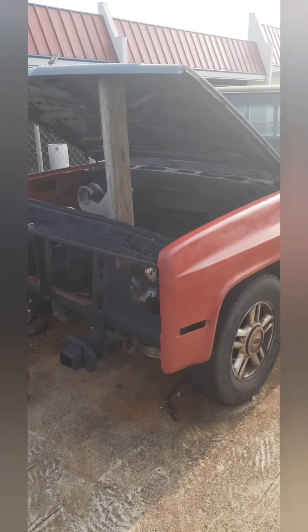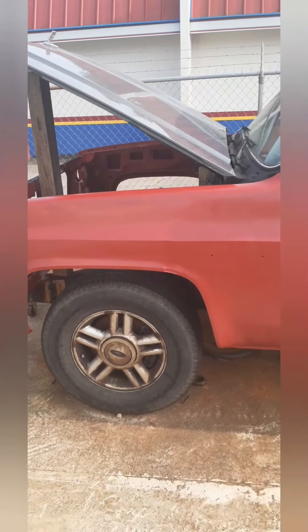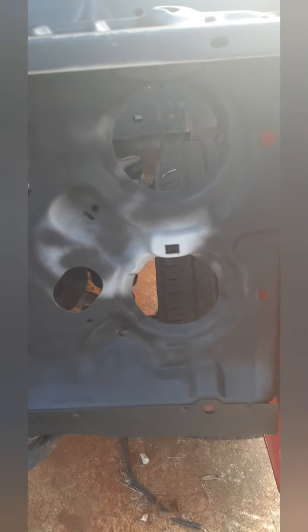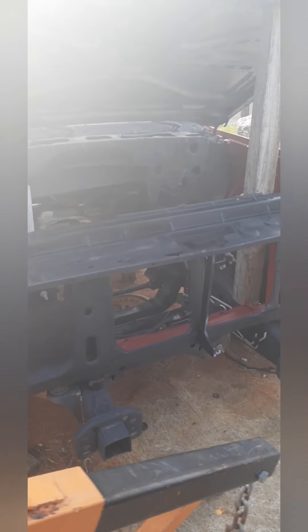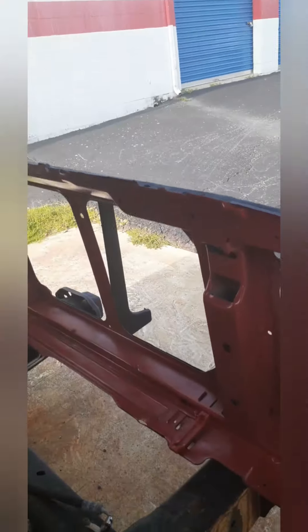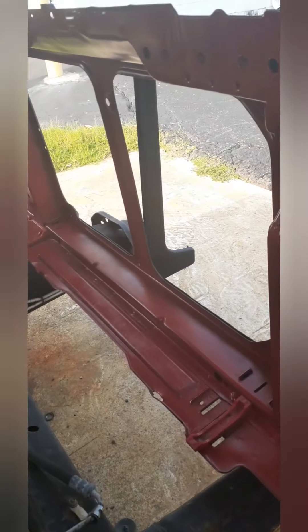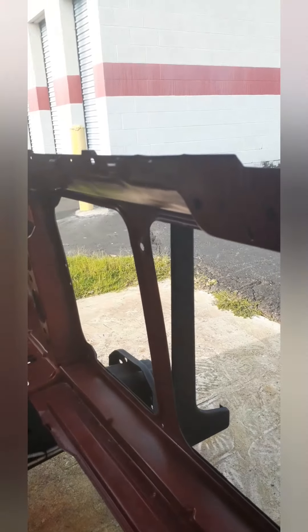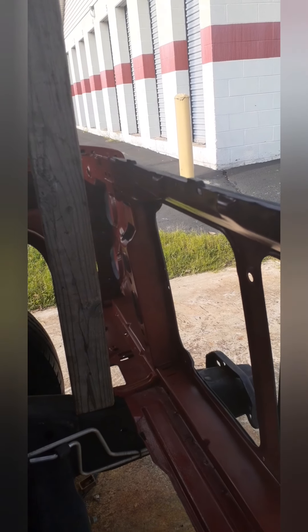So I know I finished the video, but this is the progress I've made since the last time you saw it. Y'all saw me put the paint on this fender. I've also got my core support about 85% done. I ran out of paint so I missed a few spots on that support and right here around the headlights I ran out too — got enough to get a tack coat on there but not enough to cover up all the primer. Had plenty of red, so I finished up the backside with very minimal masking and I was pretty impressed with how that turned out. Not a whole lot of black overspray, and in the few places where I did get some black overspray on the red, I just shot a couple quick squirts and covered it up.